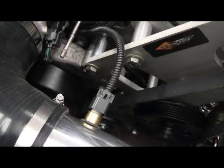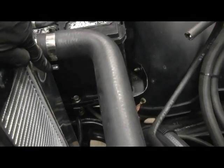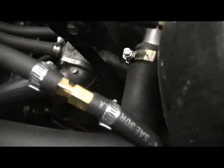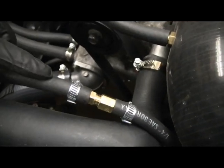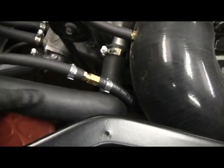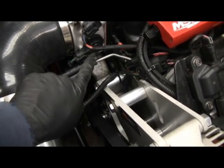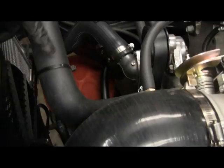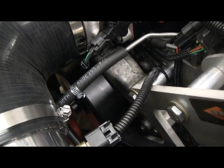There's a small problem with the steam line: where it comes out of the motor it's quarter inch, and where it goes into the radiator it's five-sixteenths. So I bought a conversion barbed fitting that goes from quarter to five-sixteenths and connected the hose — I'll hide it underneath the radiator hose. Here's the final steam line: it comes off the motor here, I tied it up here, and it goes in there. I left the clamp off on this side because when you fill it with antifreeze you'll need to take that off.